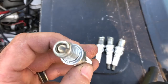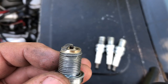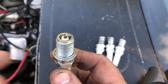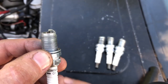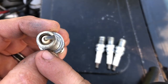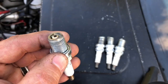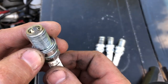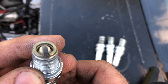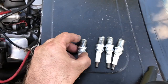First, I'm going to look at number one here. The video is probably not going to pick up everything, but this is a methanol plug - EFI methanol turbo. I was having some high boost issues. You can see the cadmium is this nice silver color here. When you look at the base ring, this is how you tell fueling. The cadmium is mostly still there. Now most of the cadmium is burned off the ground strap. This is a number 10 plug - a number 11 plug is going to show a little bit less heat in that ground strap. The timing mark is about right there - it's a little bit far on the bend, but the bend is about where you generally want it.